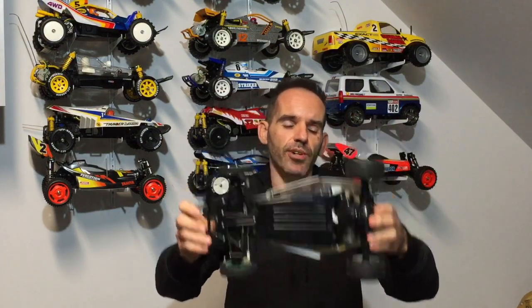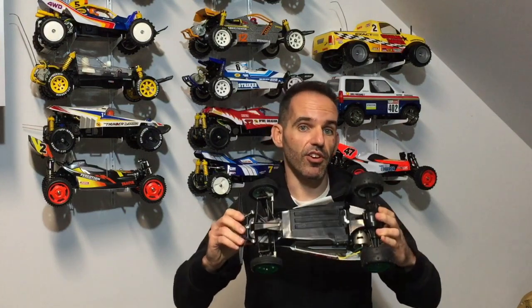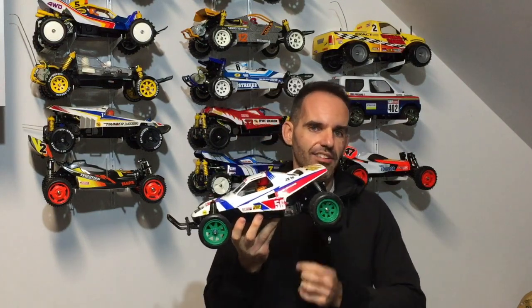Hopefully you enjoyed today's video on the ANPRO Engineering upgrade to the rear gearbox section of the Grasshopper 2. Something I didn't cover before is that this brace upgrade will suit the Grasshopper 2 and the Super Hornet because they run the same tub chassis. The Hornet I built for my subscriber runs the Grasshopper chassis with a different battery door. I actually prefer the Grasshopper 2 and Super Hornet chassis because the battery door doesn't fly off over jumps — it's retained with body post pins.